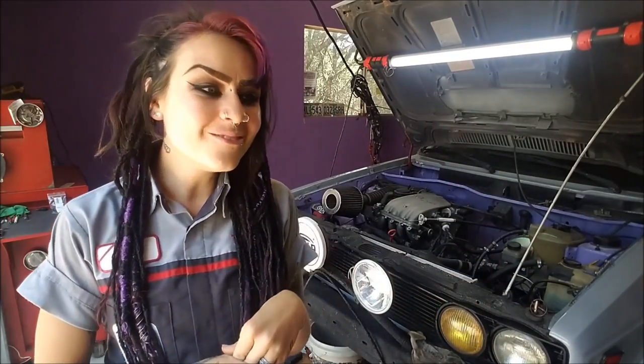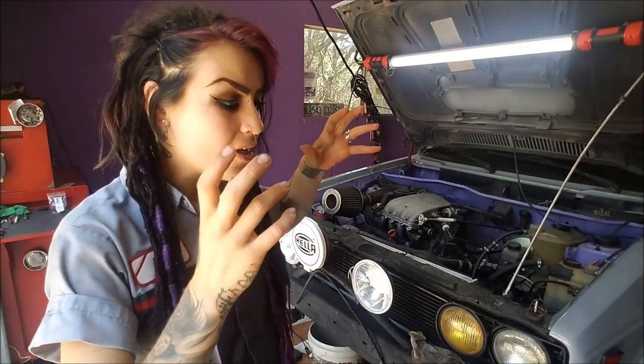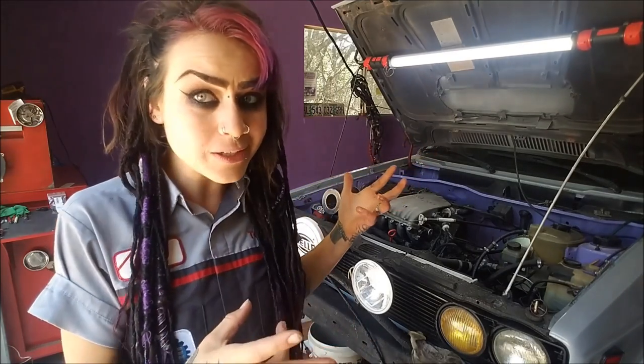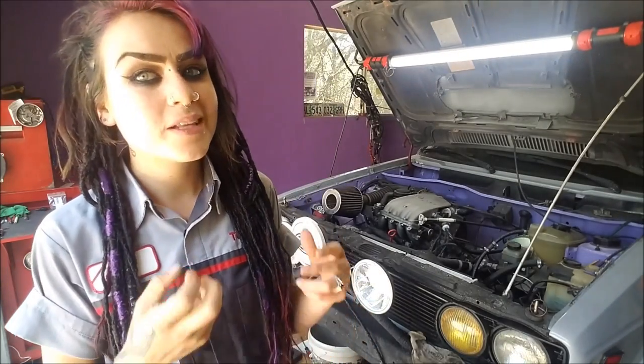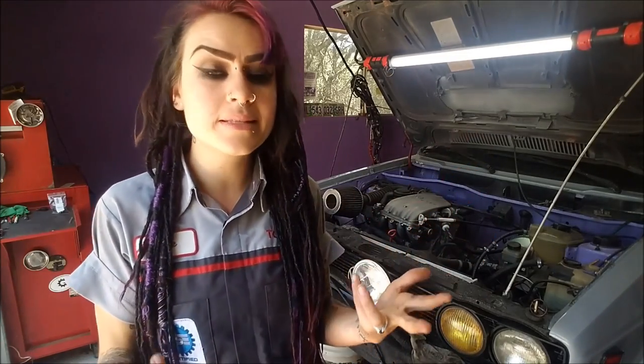So if you watch all of it and you're like, oh my God, Faye, you missed so much stuff. Okay, well in my Underhood Basics class, we identify all the engine accessories, we identify all of our fluids and where our filters are, we check, we remove, and we inspect our engine air filter, we inspect our drive belts, we remove light bulbs and check them and put them back, we test our batteries and our alternators, and replace wiper blades and, you know, all sorts of things, top off our fluids.